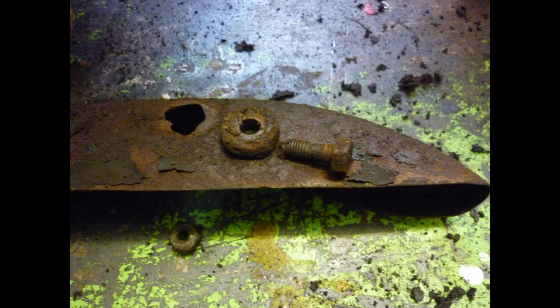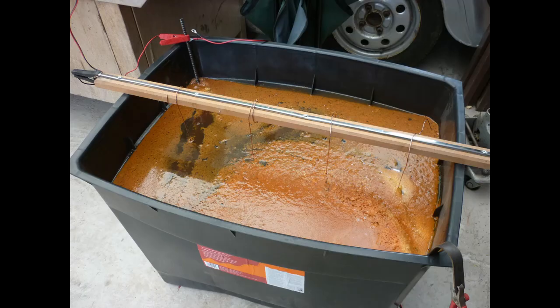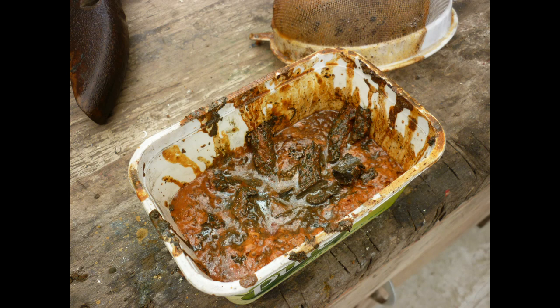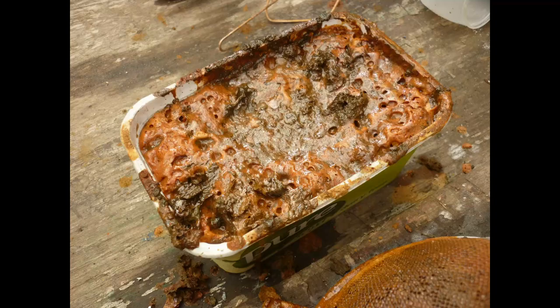I'm experimenting with electrolytic rust removal, degreasing before immersion in a 25-gallon roof water tank. A kilogram of washing soda dissolved in water, a battery charger and electrodes complete the setup. The top rail is the negative connection for components. The positive runs to lengths of sacrificial steel in the corners. The parts hung from wires. This is rust skimmed from the top. Google for further details.